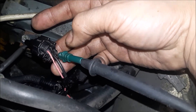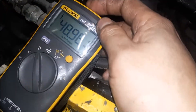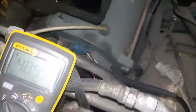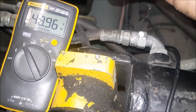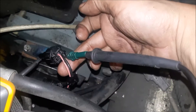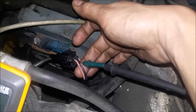The black wire is the negative — it's a common negative. Right now I'm hooked up with my black lead, and my red lead is connected to battery positive, registering 48.96 volts, which is the battery voltage. So I know I have a good negative; this wire has a negative all the time.